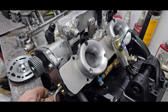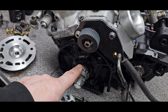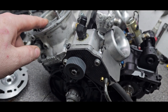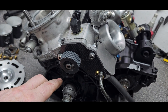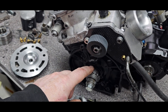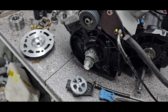The crank is new — I bought some parts from YoungBits in the UK. I also bought new rods for the RD350; those are five millimeters longer. And I bought TC-style main bearings and big end bearings. As I said, I got new main bearings for the outer, but I'm waiting for the seals — I thought they were coming today, but hopefully this week anyway.